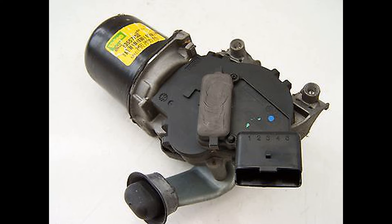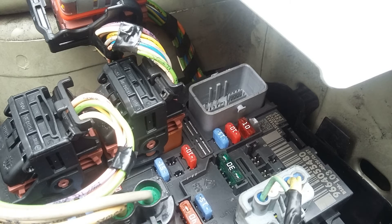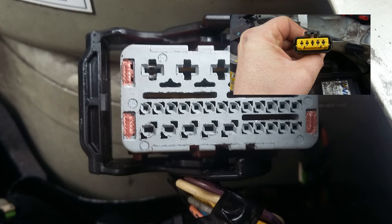If you're missing any of those supplies, you need to go back down to the BDM. As you know, the relays for the wiper motors are in the BDM and are completely unserviceable - you cannot change them. What we can do is check that the cables coming out are okay, so remove the gray connector and test the pins up to the wiper motor. Test pin 28 to 4 and pin 27 to 5 for short circuit.